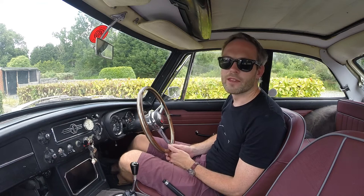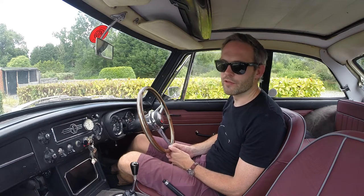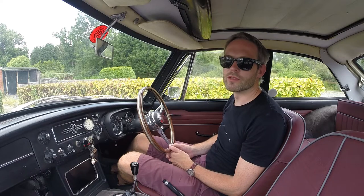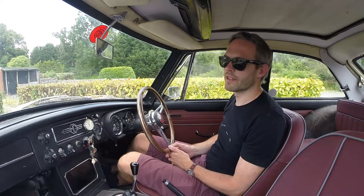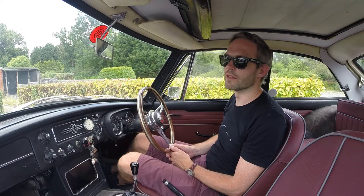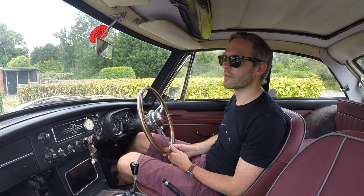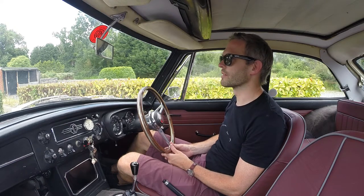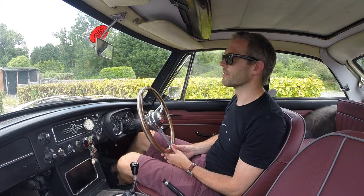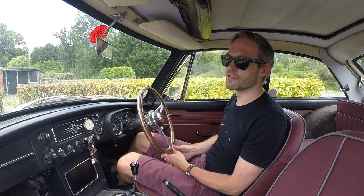The early cars also came with a three main bearing engine, and this was replaced in late 1964 or at the launch of the GT around 1965 with a five main bearing engine. This was due to customer complaints about the three main bearing engine suffering from longevity issues — up to around 60,000 miles people might start complaining about bottom end rumble and the bearings wearing out.